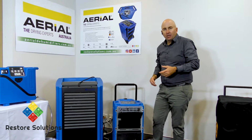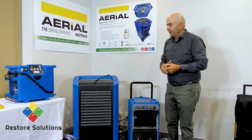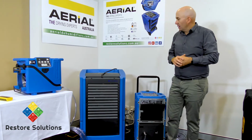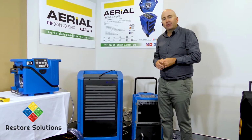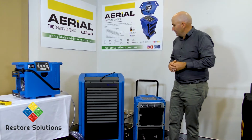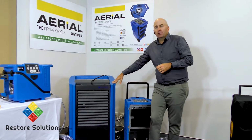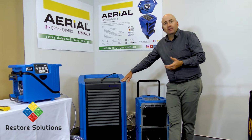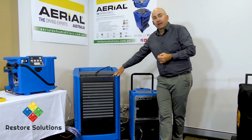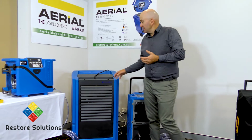So the blue dry technology enables them to go down to lower humidities and able to dry to lower grains as well. So this particular machine here, the 8780, will dry up to 40. It works up to 43 degrees and goes down to 3 degrees. So it pulls, litreage wise, up to 35 litres at 20 degrees. So it's down to 10 degrees, it pulls up to about 20 litres. So it pulls an exceptional amount of litreage at lower temperatures as well as up to high temperatures.